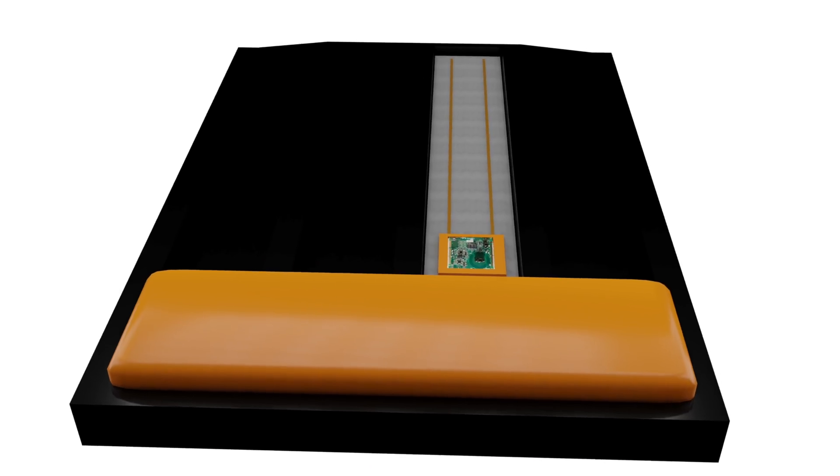In the case of this prismatic cell, they're going to use LFP — lithium iron phosphate. The F comes from the periodic table symbol FE, the Latin name for iron. One of the really great benefits of LFP is that iron and phosphate are both pretty abundant, and so is lithium, so the battery overall is just easier from a raw materials perspective. You don't have the pretty shady practices of cobalt mining happening in parts of Africa, which results in cost savings. One drawback is it's not as energy dense, so you won't have quite as much range for the same mass of battery chemistry. But one positive is that it has really good cycle life — lithium iron phosphate batteries might potentially last even longer than Tesla's other NCA batteries.